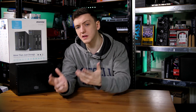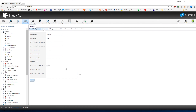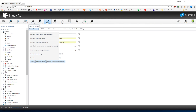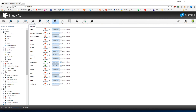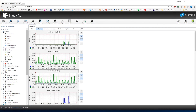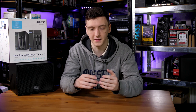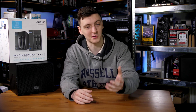For the operating system, I personally recommend FreeNAS — it's free, Linux-based, incredibly easy to install, and feature-rich. It's one of the most popular NAS operating systems. It can actually run from a USB stick, which they mostly recommend, so you don't have to buy an SSD. Just get a 2GB+ USB stick, ideally USB 3.1, plug it in, and leave it — that's your operating system running right off it.